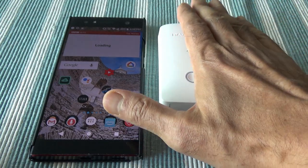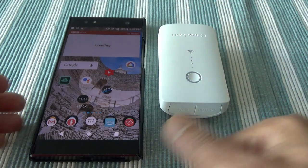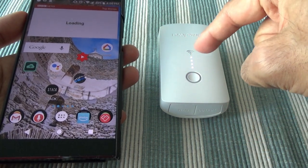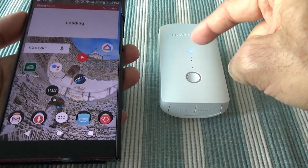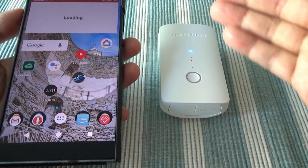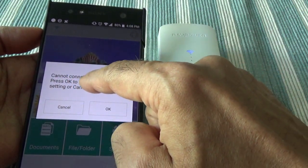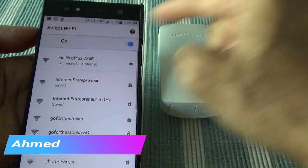Hello everyone. Right now I'll show you how to connect your File Hub Plus RAVPower to your existing internet, or to the internet you'd like to rebroadcast as a RAVPower internet. The first thing you're going to do is just turn this on by pressing it for a few seconds — one, two, three — and then you'll see the lights showing up. Wait for a few seconds, you'll see a steady blue Wi-Fi sign, and then this will change to flashing blue, meaning it's looking for the app on the phone. We'll open the File Hub Plus app. You may see a message that it cannot connect to File Hub Plus, so just press OK.